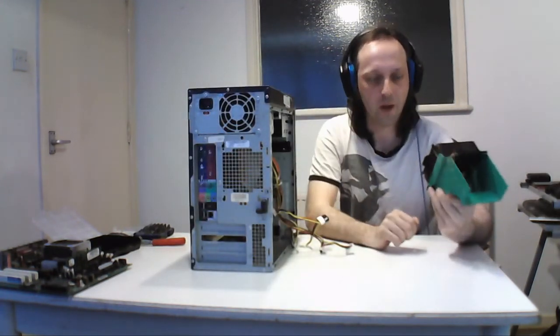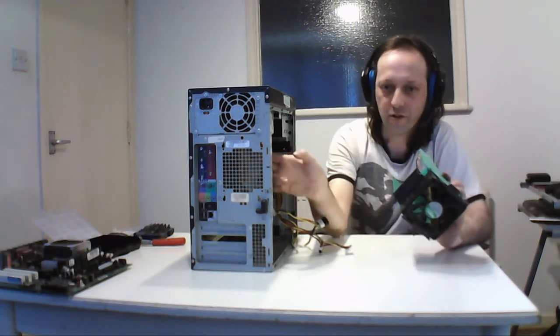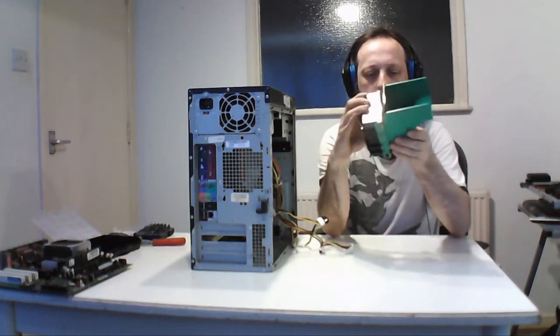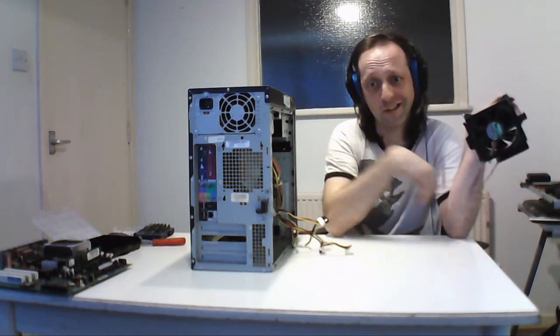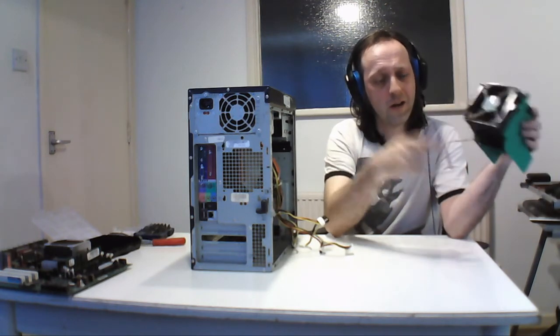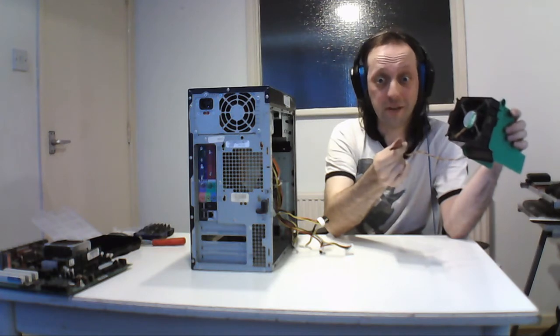This is the only outlet fan, and this is also the CPU fan. So I'll show you when I take it out. It's a big heatsink, and this fits on like this. This does open. I think if you push it down, this does open upwards so you can clean it. But generally, this is the main exhaust fan for this. So it both takes air out of the system and also the CPU. And it uses its own unique 3-pin, so you can't put it on the other system.